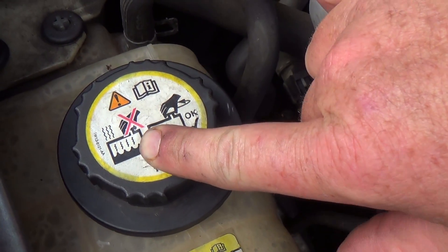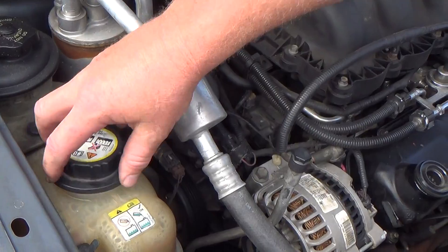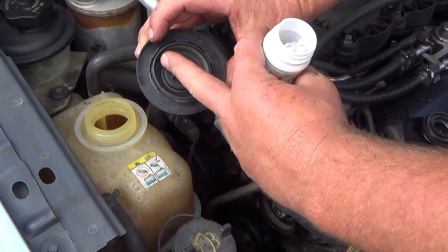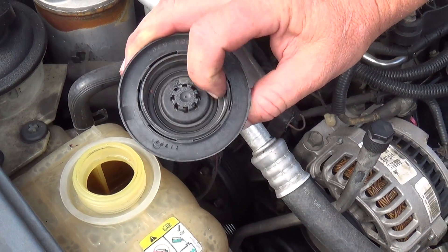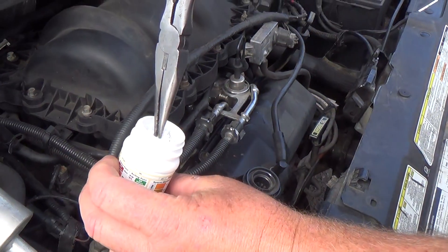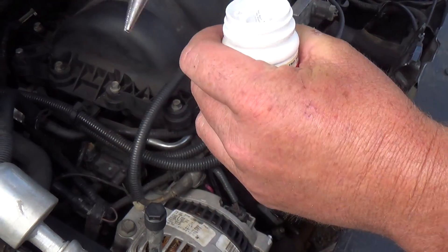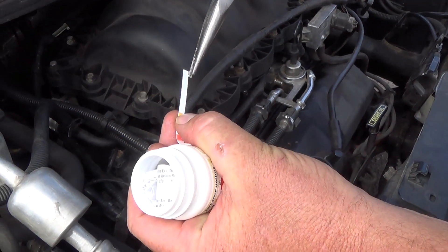Once you verify it's not hot and pressurized, take the radiator cap off appropriately. Every radiator cap warns you not to remove it when the vehicle is hot. Visually inspect the inside of the pressure cap — make sure you don't see cracks, corrosion, broken pieces, or a damaged seal.